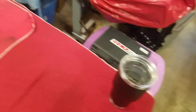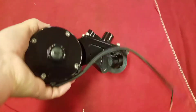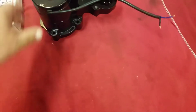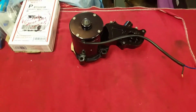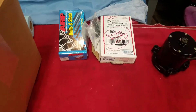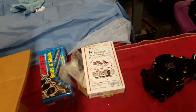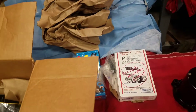I got a Messer pump — slightly used but I got a pretty good deal on it. These things are super expensive. I've been running a stock pump the whole time and it's worked okay, it's just hard to regulate temperature consistently when you leave the line. So we're upgrading to that. I also got Accu-Fab secondary chains. This time I'm putting head studs in, so hopefully we won't have any problems lifting a head. I'm sticking with the same cams — the Comp NSR Stage 3s — more of an NA cam but that's what I've got. We're just going to degree them in properly and not follow what Comp says, because they sent me to left field last time.